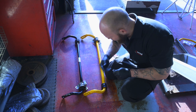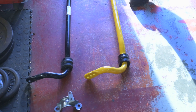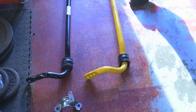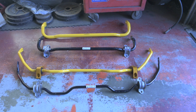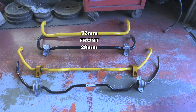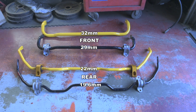Now we've got the factory anti-roll bars and the replacement ones on the floor, we can have a look at the differences. The first thing to note is there's one mounting hole in the standard bar — so no adjustment. In the replacement bar we've got three different holes, which give you three adjustments for stiffness. The closer that hole is to the bar itself, the stiffer the setting will be. That adjustment is particularly useful if you want to take your car on track. We can also see that the uprated bars are thicker — on average about three millimetres thicker than the factory examples — meaning they are overall stiffer and more able to resist the roll.